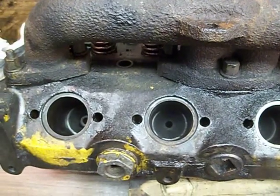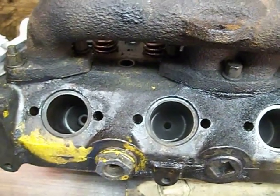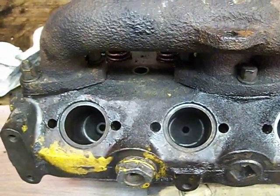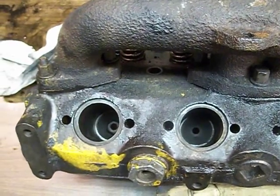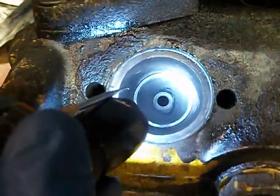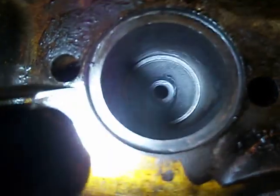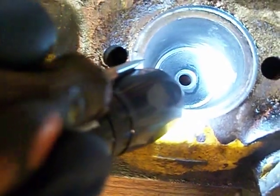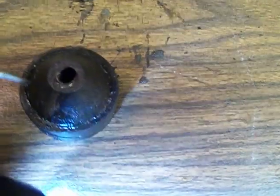I didn't really talk about it, but I left in the comments about these spots inside of these combustion chambers and I was kind of wanting to know one of two things: one, is it going to ruin the cylinder head, and number two, what causes it? So this is cylinder number six — it should be able to see in there pretty good. There's a little bit of erosion but nothing like the other engines. I've got a pick tool here I want to use to try to point out the interesting areas that are kind of like eroded out on these other cups.